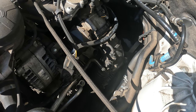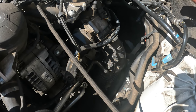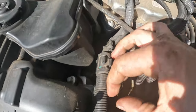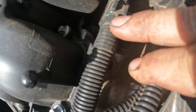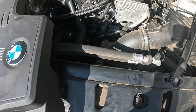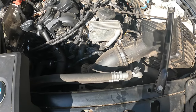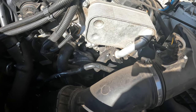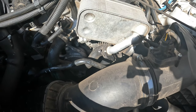The biggest reason you have to take the subframe out is because the pan hits the bottom of it. You're going to need to jack the engine up as high as you can. There's a tow hook for these BMWs — thread it right down in there where my finger is, and it holds the engine up on the front end. You can use an engine holder bar across the strut towers.